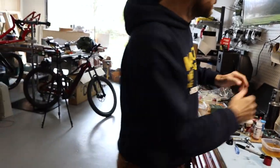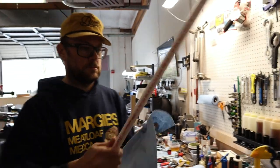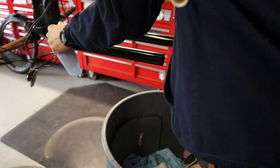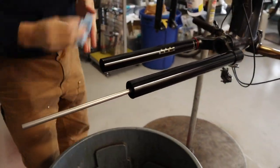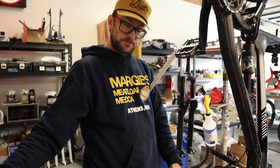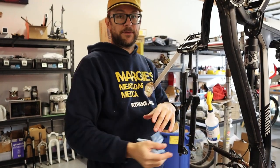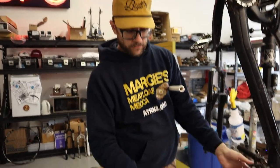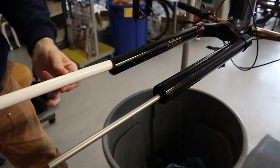I'm going to get a fresh rag inside here. So you need a piece of like a dowel or a piece of plastic tube. This is rubbing alcohol. These tubes are tapered internally — there's a narrow wall here and thicker up here. So I always push the paper towel from the bottom to the top. That way it squeezes it as it goes and makes it easier to get all the crap out. If you go the other way, it goes from tapered thick wall to thin wall and gets easier, and you can miss some of the grease on the way out. I just get better results cleaning by pushing it up through the top.